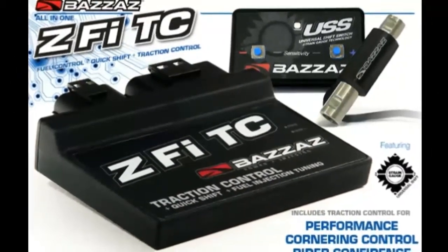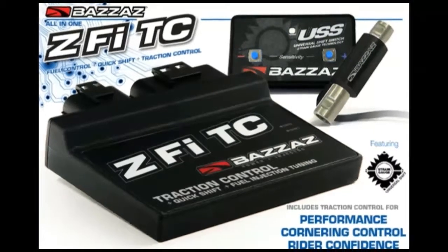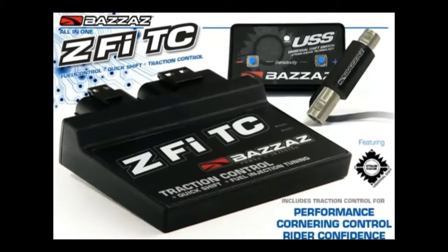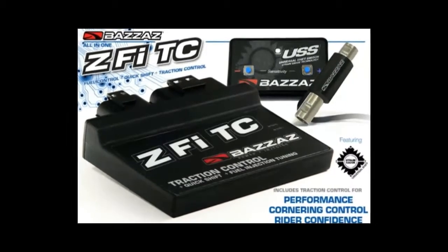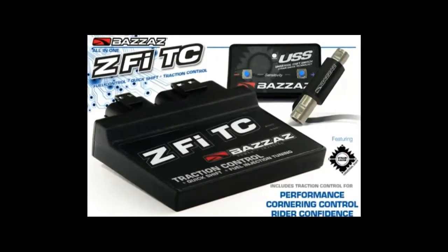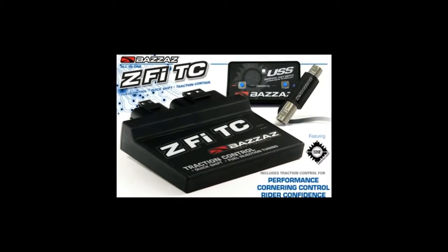That's really the crux of what we do, says Herschel Auxia, the engine management and data acquisition technician for Yoshimura Suzuki racing. We find the balance of pre-existing settings that we have used and settings that are specific to the track to find the fine line of using the aids effectively and not slowing the bike down. This process is new for every race. The riders almost never go out on the track with the same mapping twice. Weather, temperature, track conditions, and rider style all have Auxia scrambling to come up with the best setup to give Yoshimura's riders an edge over the competition.